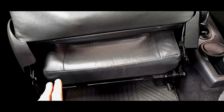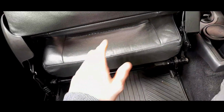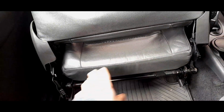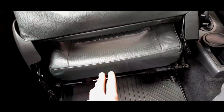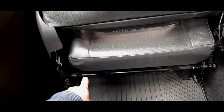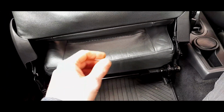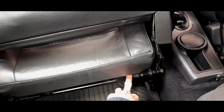But one thing to note, the seat bases. Now, when you're refurbishing the seats, you just take the seat bases out with the four bolts, like I said, okay? You will have then access to the frame itself. Now, the frame is very common for rotting. There are parts of mine which I was really concerned about. I don't know whether mine have been near the sea, but I have actually seen this on a number of Mark 1s where they actually get really rusty.